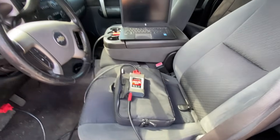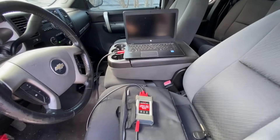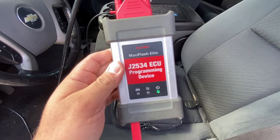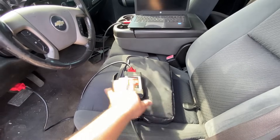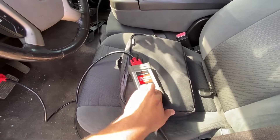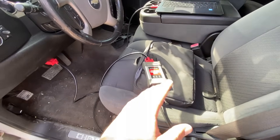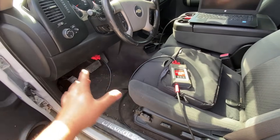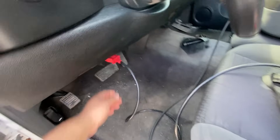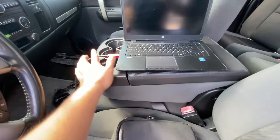Now if you look over here, I have a few different things. Number one, I have my laptop — this laptop is dedicated just for programming. Over here we have our J-box, this is our J2534 programming device. The one I like to use personally is this Maxi Flash Elite — it's the one I've been using for years. It works for mostly all the vehicles I like to do. I do probably eventually need to get a new one because a lot of new vehicles require a four-channel box and this is still only a two-channel box. However, this still takes care of more than 80% of the vehicles on the market — it works for GM, Ford, and a lot of U.S. domestic and Asian imports. I have it connected to the OBD2 connector, the 16-pin DLC, and on this end I have my USB cable running to the laptop.